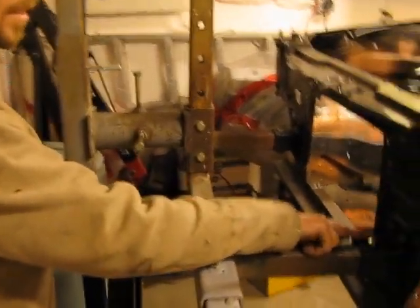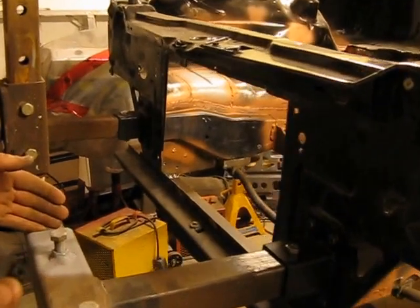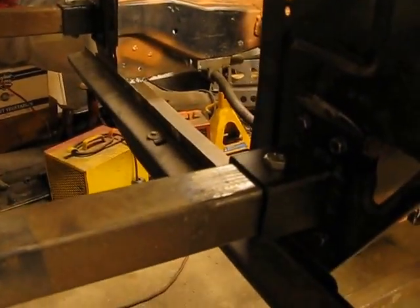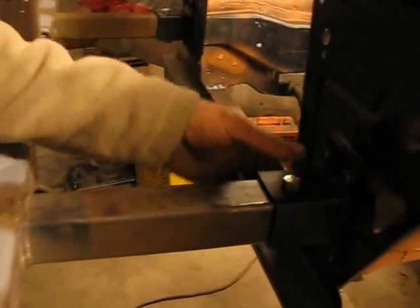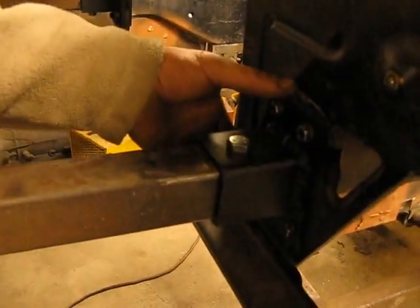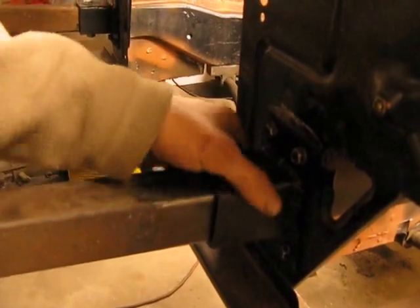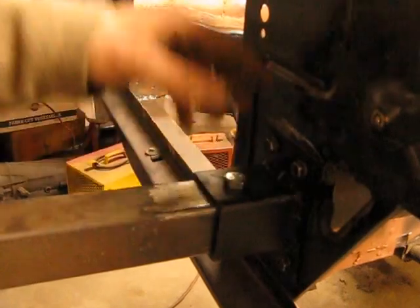In here you can see that because this car was made for larger cars — like possible Chevelles, Malibus, Oldsmobiles — there were much larger vehicles using these bars that stick inside the frame. For this one, specifically the Chevette, I had to remove the bumper shocks. I made a 1/8-inch plate on a 2.5-inch square tubing, welded it to the plates, and it is now supported to these T-bars, evenly spaced between one side to the other so everything is central.